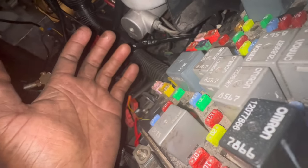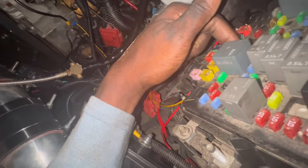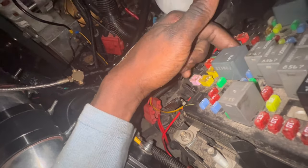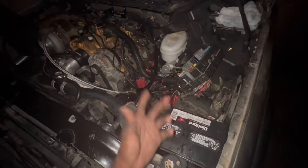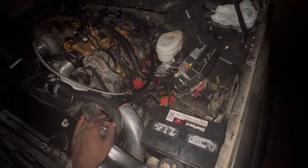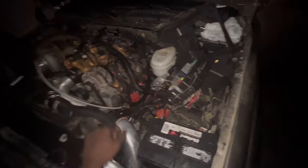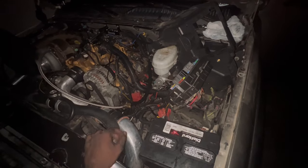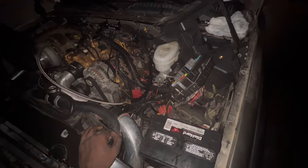I know I've got good ground and stuff. I think the PCM is supposed to send the ground to pin 85, because it's going to close the circuit — it was going to send ground so the circuit would be able to close and send power to that starter. But it might not be able to do that if it can't go through the neutral safety switch. We've got power, but if it ain't coming back some way, then yeah, we're going to be stuck.